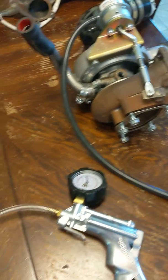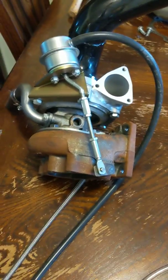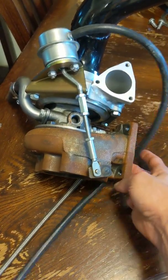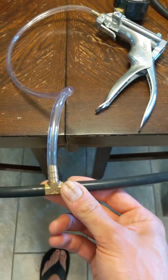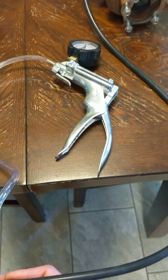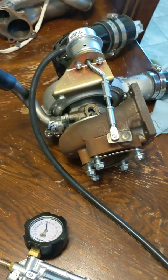My strategy was to set them up one at a time first and then go grab the actual hoses right out of where they would be in the engine bay, so I have the exact length and distance, which normally would be teed off to the boost controller. But in this case we're going to tee it off to the Mighty Vac, and this will show me if they're both opening at the same time.